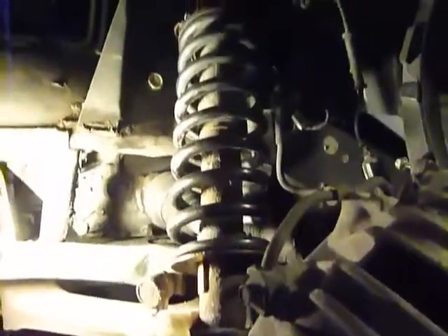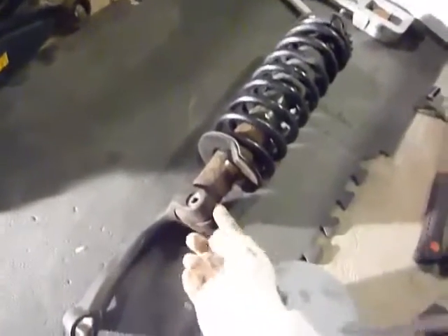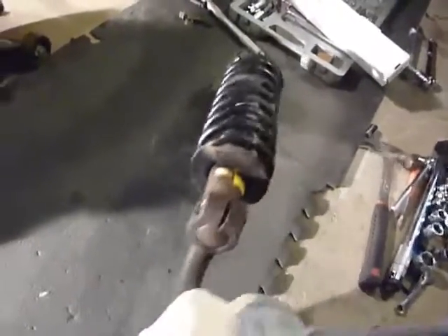Bolt out — do not touch the center, just another reminder. Down here and out comes our second. Move this over and proceed to compress the spring. Now we've got the strut assembly removed. We're gonna take the arm off — use a BFH if you will. Get a screwdriver, pop it in here to spread these out, then gently tap the arm to remove it from the strut, or hit the bottom of the strut to get it out.